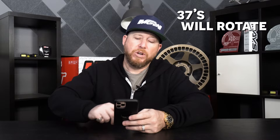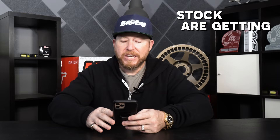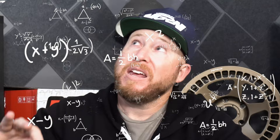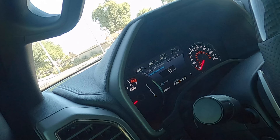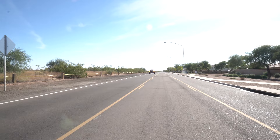The 37s are obviously taller than the stock 33.5-inch equivalent. The 37s rotate only 545 times per mile — rotating slower because there's more diameter — while the stocks get 587 revs per mile because they spin quicker. Doing the math, putting stock tires should probably improve the 0-to-60 time by another 0.4 seconds, which is not bad.